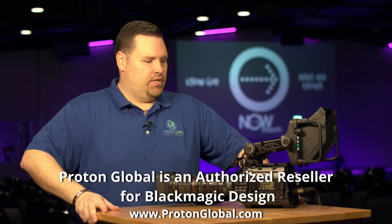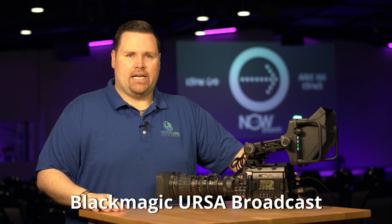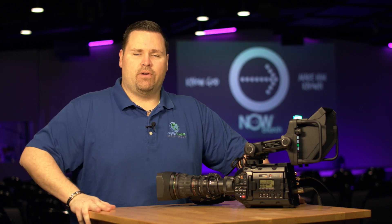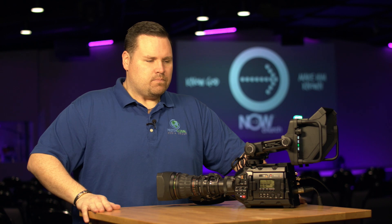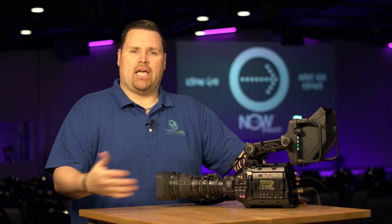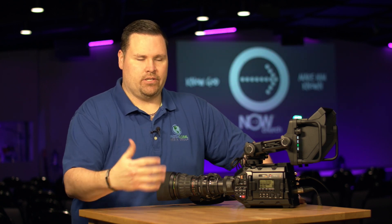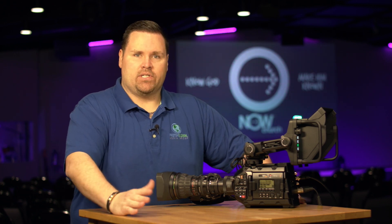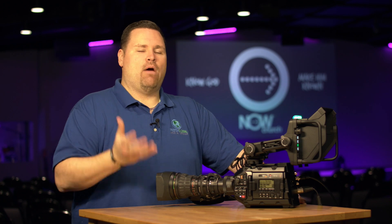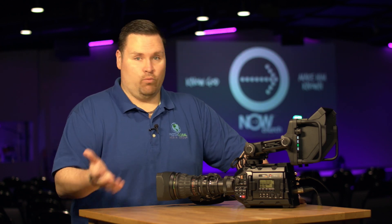We're constantly upgrading and changing things here, but we test a lot of stuff. This is the new Blackmagic URSA Broadcast. Let me give you a little backstory — some of you may have seen our review about four years ago for the Blackmagic Studio Camera HD. There was so much great response on that video and so many questions from all over the world. Really there were some shortfalls on that camera. Over time it proved out because everybody had the same questions. The dynamic range on that camera wasn't great, so if you didn't have adequate broadcast-style lighting you'd have to gain up the camera to get adequate light level, and that would cause a lot of grain in the imagery, especially in the blacks.